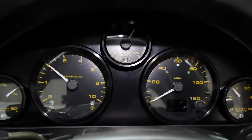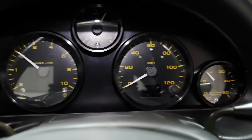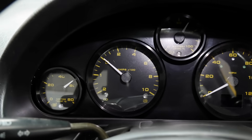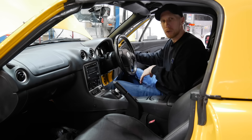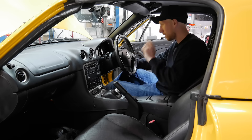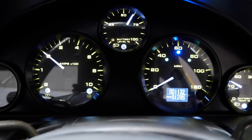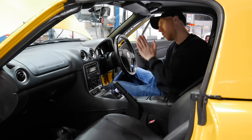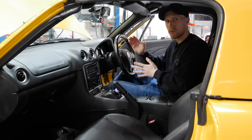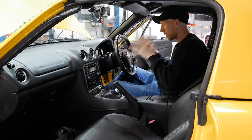They program it all for you and send you a really nice set of gauges. In here we have motor temperature, amps, battery state of charge, speed along with indicators and high beam — which are obviously requirements for UK roads — as well as the ABS light, just to make sure we don't annoy any of the MOT testers, and battery temperature. The big benefit with the amps gauge is we actually sit at zero, so when you're driving you're using amps, but when you're doing regen it kicks downward so you can see how much you're putting back into the battery.